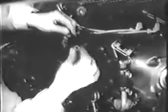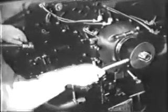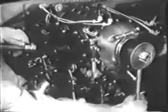With the PAL nuts off, remove 4 of the 6 hold-down nuts, leaving 2 nuts on temporarily to hold the cylinder in place. Before pulling the cylinder, put the piston at the top of its stroke so that you can get at it when the cylinder's off. You can do this easily by turning the crankshaft with a timing tool and watching the piston through a spark plug insert. Now you can remove the last 2 nuts, and the cylinder will be free to come off.